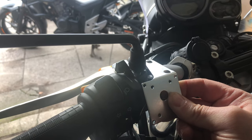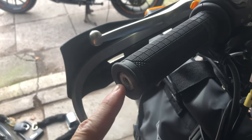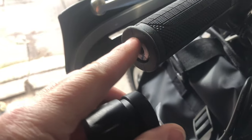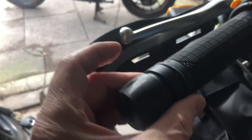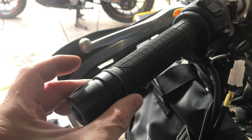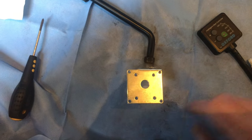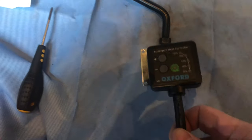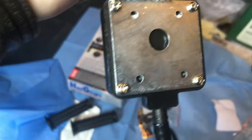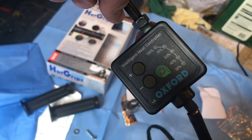It fits on very easily. It's quite a common thing when fitting these grips that they're slightly longer than the originals. You can cut the rim off, but I'm going to use a spacer so it stands slightly proud. That's fine on this side, but on the twist grip side it would mean the throttle sticks, so we'll need to sort that out. Before fitting the bracket onto the bike, we need to mount the control unit on first, otherwise I won't be able to access the screws — they're fixed at the back. It uses these tiny little Phillips screws. We've got all the screws fitted onto the back plate, mounting the switch, so we can now mount that onto the bike.